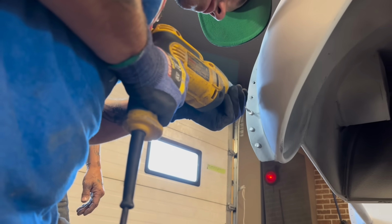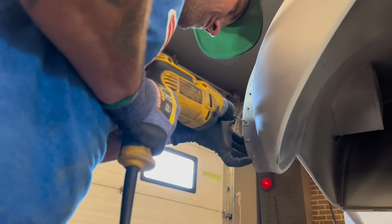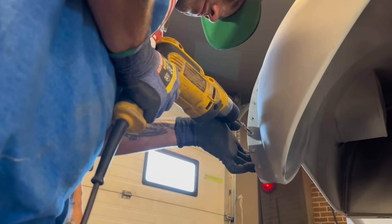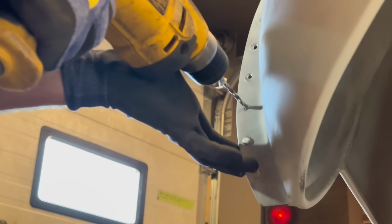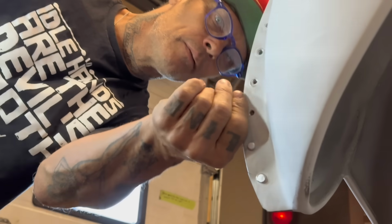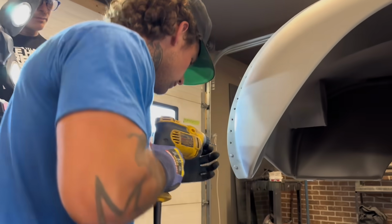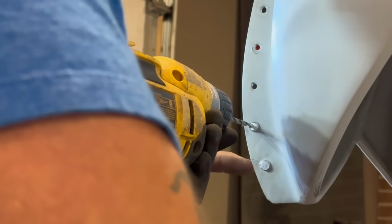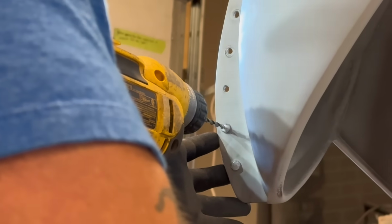That's not right in the middle. We'll just go down, open down, and your drill bit down. Yeah. It's causing damage right up to about here, but there's nothing we can do about it. We're just going to go back in there and sand that down. We'll have to take probably a 220 grit, maybe even 80 grit. There's some places where we're going to peel the primer right off.